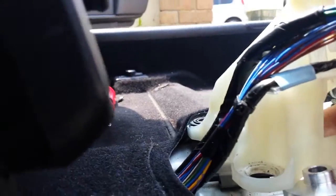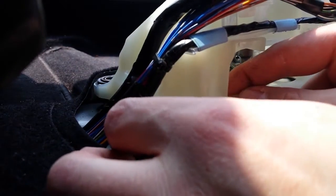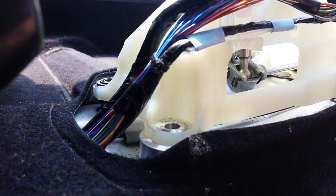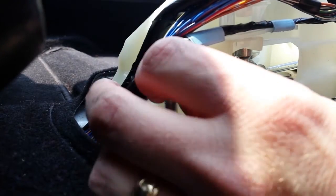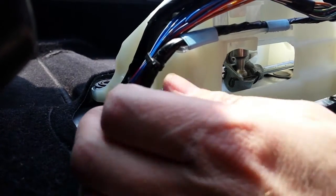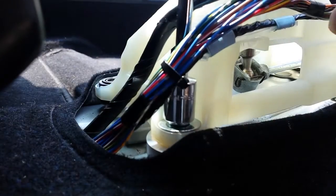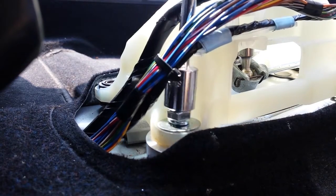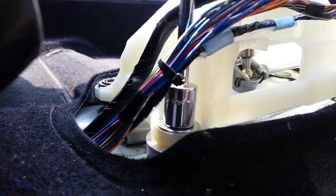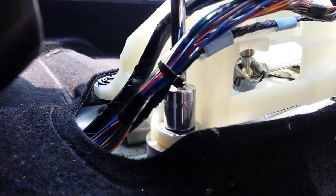So simply lift the gear cage up a bit and put your new bushings in place. They'll just sit and locate at each point in the corner there, and then once it's in underneath, it's washer, spring washer, and then bolt through the top of it. My advice would be, as I'm about to do here, don't tighten them up. Perhaps just locate it in the thread of the floor pan, because these bolt straight into the floor pan, because you do need to have a little bit of play in the existing cage to be able to get all the other mounts underneath and then get the bolts into the existing 4 mounts.